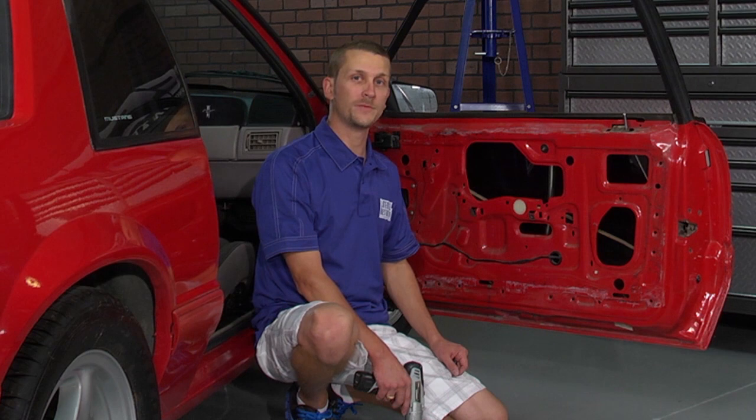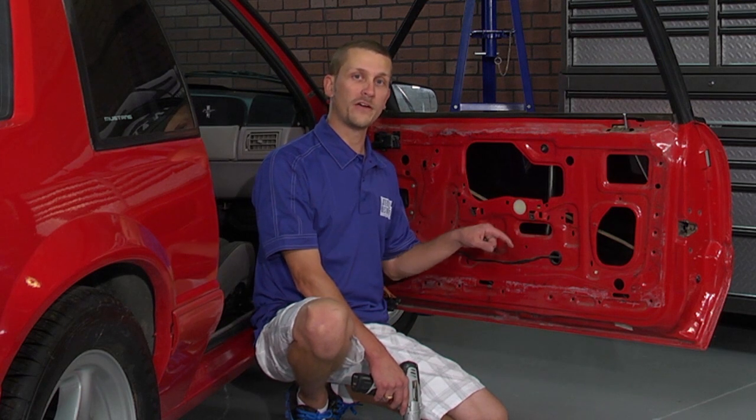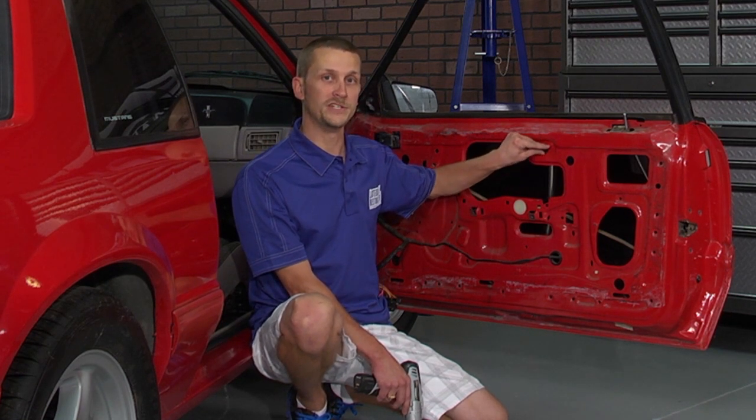Just a quick little note before you get your guide rod back into place: go ahead and wipe off all the old grease and contamination so you're starting out fresh. Then grab some new window motor grease and apply it around the guide bushings at the rod area for lubrication. You can grab window motor grease at your local auto parts store. And when it comes to putting the nuts back on your guide rod, on the top, use the check marks created whenever you took the nut off for your preliminary adjustment.